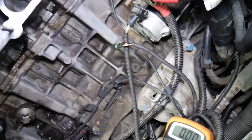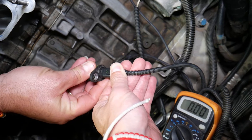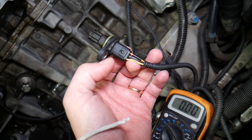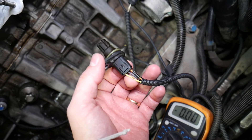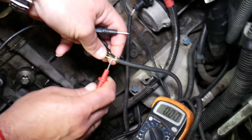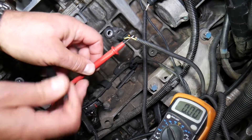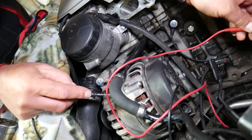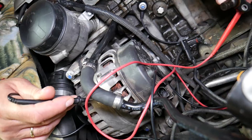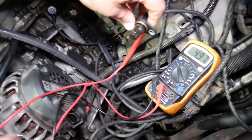At that point, you should turn your car off and make sure the ignition switch is off. We're going to put the sensor all the way in. We peel the wire a little bit — that's the yellow wire we need. I recommend not to peel it though; there is a special device you can clamp to it, and we will share the link in the description below. We're going to touch the red probe to the wire we peeled and the black probe to ground anywhere on the engine, so you don't have to peel the ground wire on the sensor.